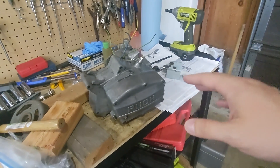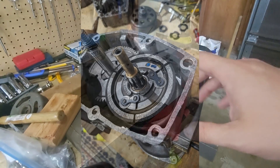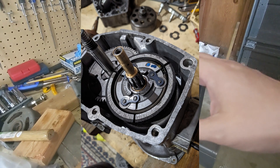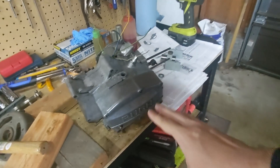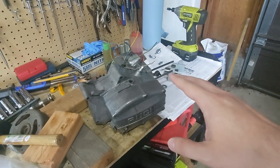Just some miscellaneous transmission things to mention. I did flip the second gear clutch - that's popular on a ZA50 where you put some performance parts on it to give you a more delayed shift in second gear. There is also the end transmission shimming. I actually just popped this cover on temporarily and I'm going to go ahead and do that today as well.